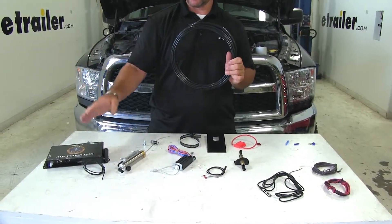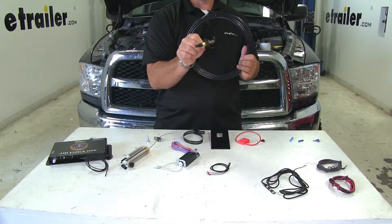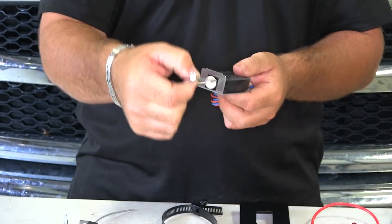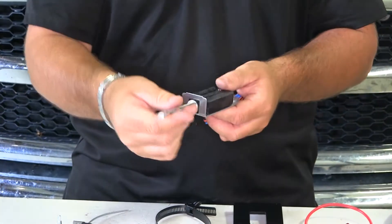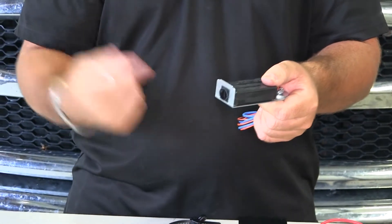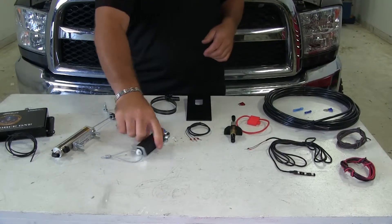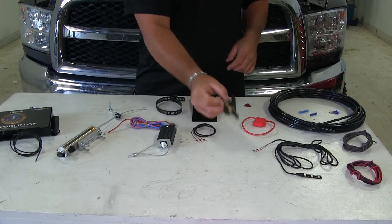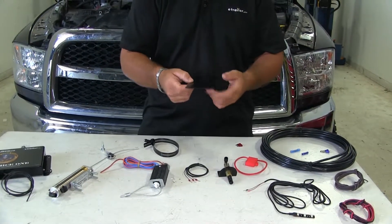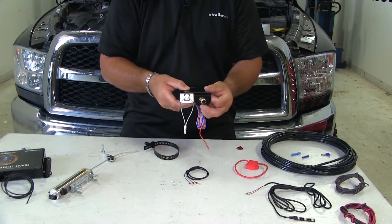This is your roll of airline tube that's going to run from your air in and out ports from your operating unit to your cylinder on your brake pedal, and then the other one will run to the air out on the front of the vehicle. Next we're going to have the breakaway switch. It's going to have a cable that connects from the end of this cord to the hitch on the RV. If anything ever happens where the vehicle becomes separated from the RV, it will pull this switch and automatically apply the brakes in the towed vehicle, bringing it to a stop so it's not bouncing around the highway causing an accident. To mount your breakaway switch and air outlet, I suggest getting a long bracket — it's going to mount to your base plate, and we'll drill a couple of holes to mount both of them side by side.